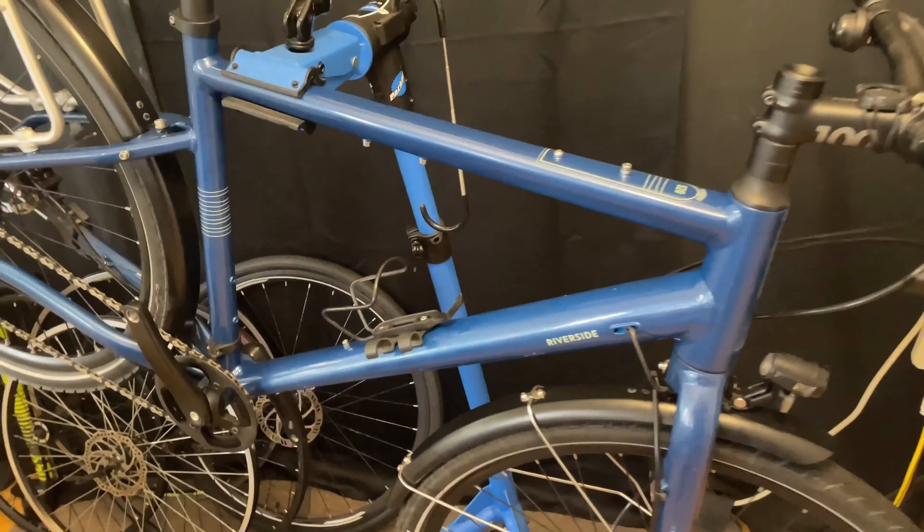So the derailleur is working perfectly fine except for that small cog. There's still some resistance on the crank — we'll see in the next video whether fixing the rear derailleur fully cleans that up. There's just a little bit of resistance and I'm only using one finger, so it's not huge, but for a bike at this price point everything should be working perfectly. We fixed the front wheel as best we could using a truing fork on the center lock rotor. Everything is spinning nice and smooth — with the dynamo light on it spins quite smoothly, and with it off it spins forever.